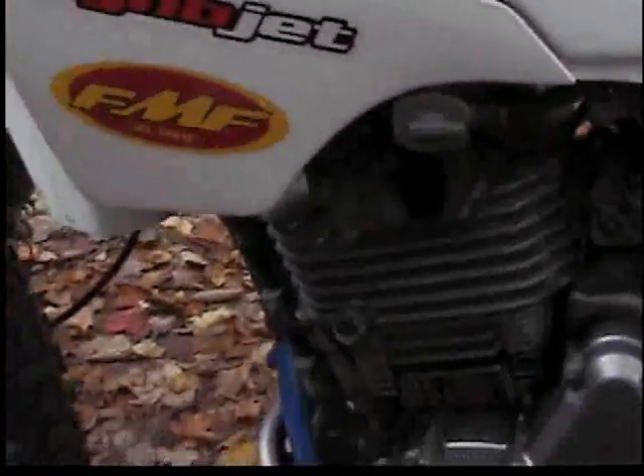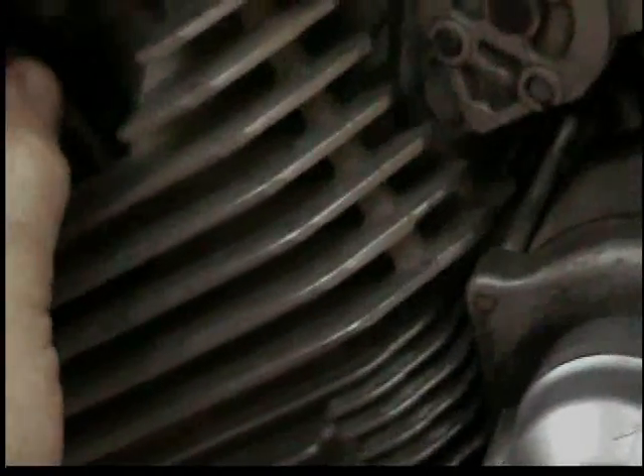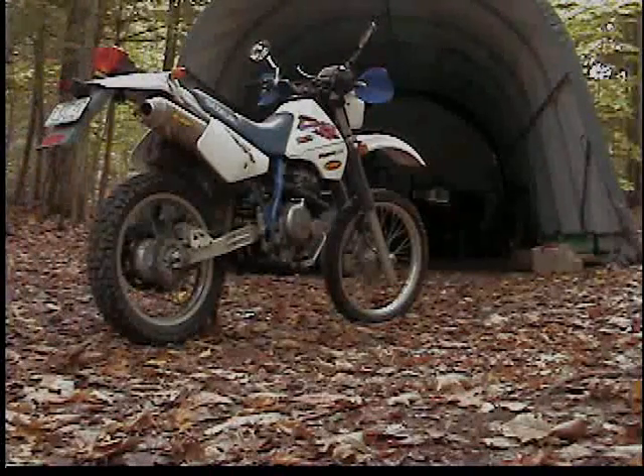Well, to be honest, I've never had this much trouble starting this thing. I pulled the plug out because I figured I was flooding it — I've been cranking on it pretty good and they don't exactly make that easy to get to. You can see the spark plug socket is 18mm. Anyway, the plug is dry as can be, so she's not getting any fuel. I can smell gas but it doesn't smell too good — everyone knows the gas we get today doesn't last too long, it smells awful. It'd be a good thing to check how much gas I have in there.